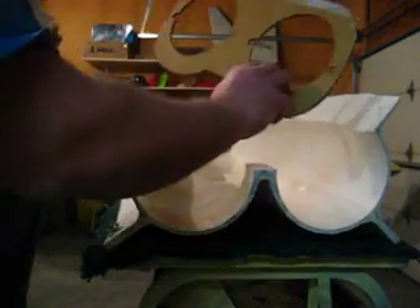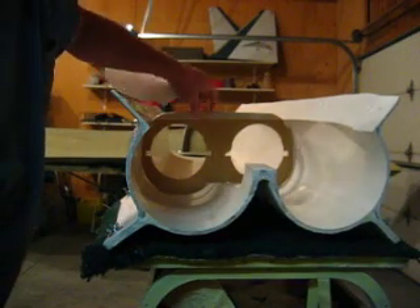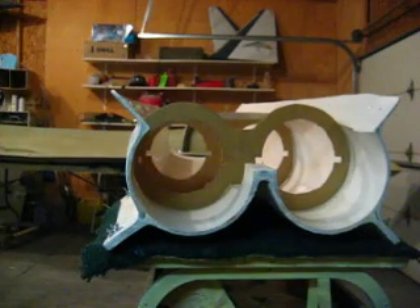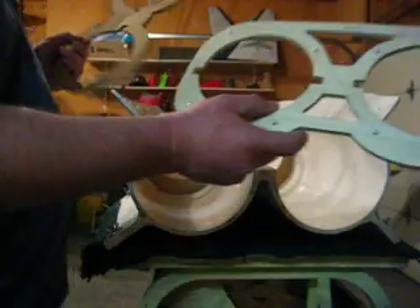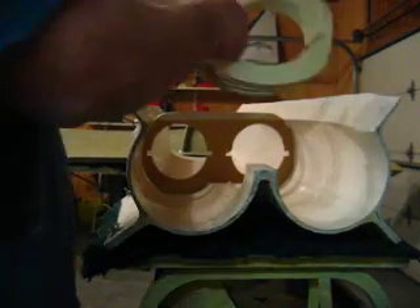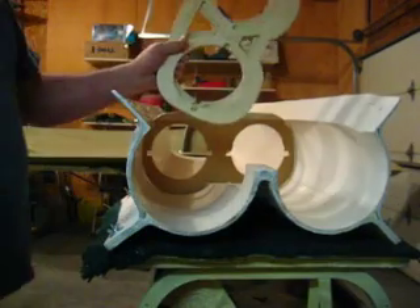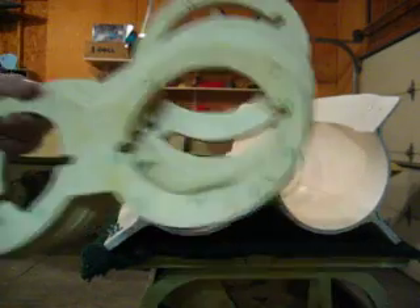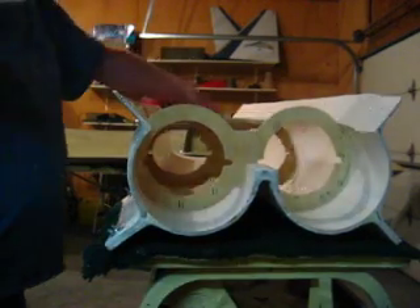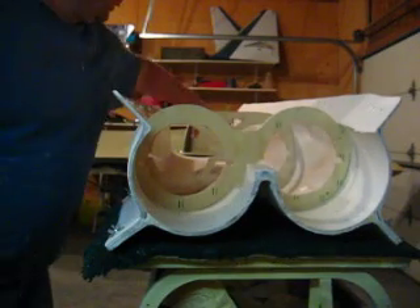Then I transferred it to a piece of cardboard, stuck that in there, and got it fitting pretty close. Where I cut it a little too short, I just taped a piece back on there and got it fitting. Did the same thing with this bulkhead here. Once I got it fitting real good, I transferred them to the wood. This is my masterpiece. I spread them to a piece of wood, took my router to it, and just went around the edges. There's enough for two nacelles — I've got the back ones and the front ones. They fit in there just perfectly. My duct will just go from square to round, right there — real simple.